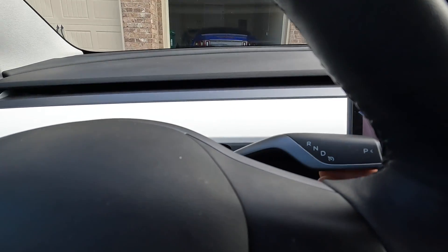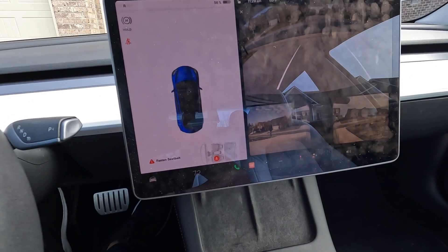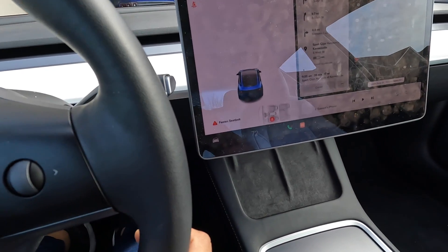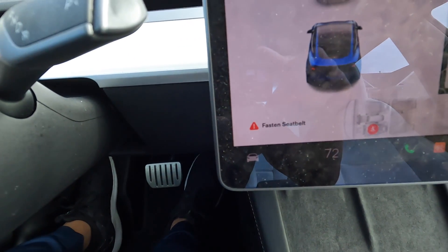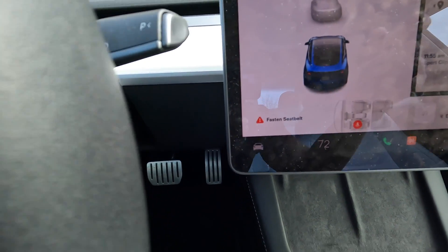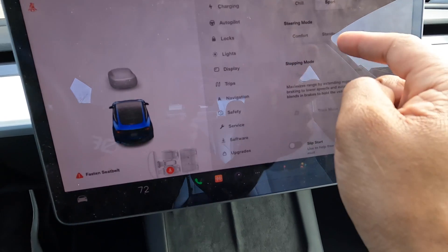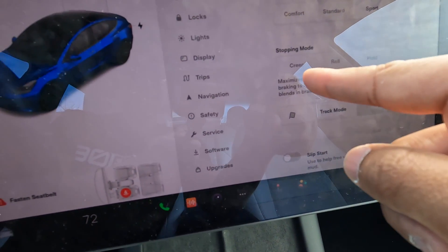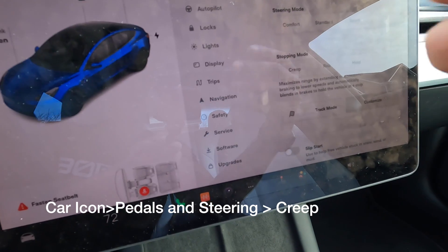So you're ready to get going. Come down here — push the stalk all the way up for reverse. You can go in the car and all the cameras come on. Release the brake and press the gas and you'll start going. If you need to go to drive, press the stalk all the way down. Most of these cars are set up so the brakes automatically hold — right now I let off the brake and the car holds itself. You can see the brake lights are on. It won't go until I touch the gas pedal. There are different ways to configure that. I like this method because you can drive one-pedal style. If you want it to feel like a traditional car, press park first, then go to 'Stopping Mode' and set it to 'Creep'. Creep is more like a traditional automatic where you release the brake and the car moves forward.